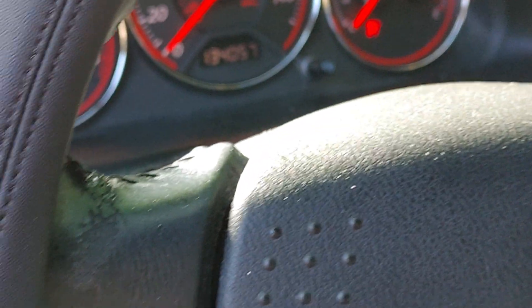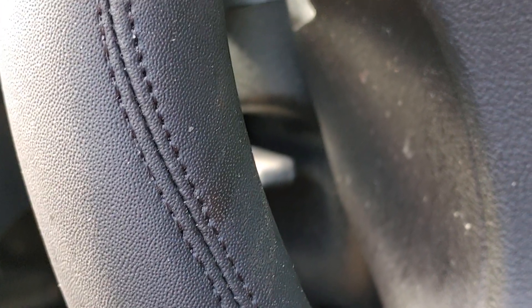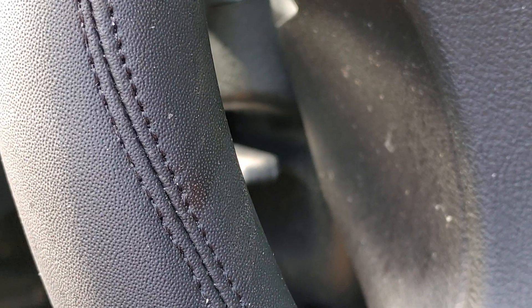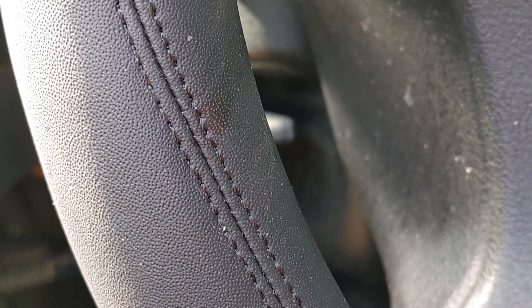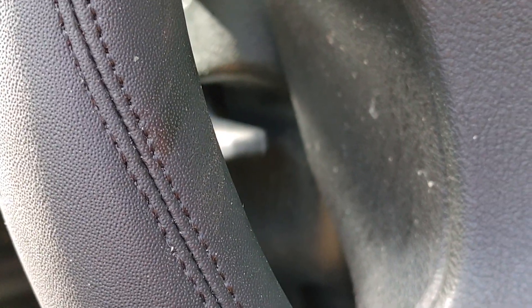I'm working on a 2005 Honda Civic LX. If you turn on your turn signals and they make a buzzing noise, it's probably a bad relay. It's probably not a fuse, but you can check your fuses — there is a fuse for the turn signal.